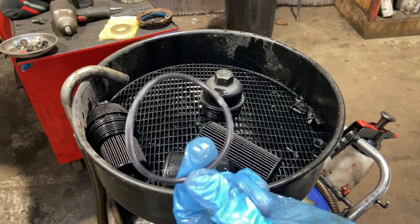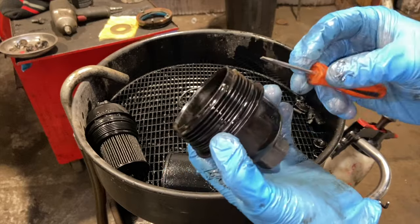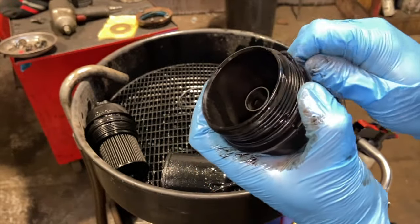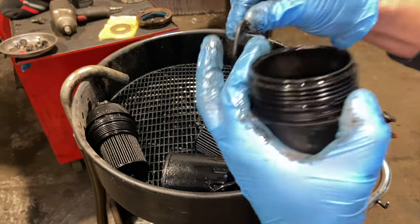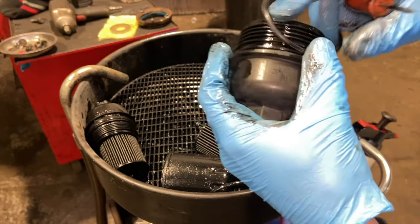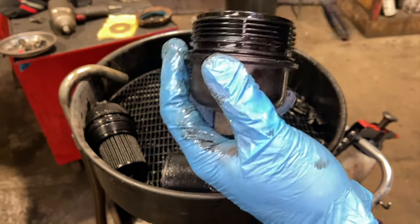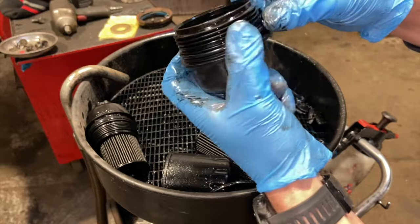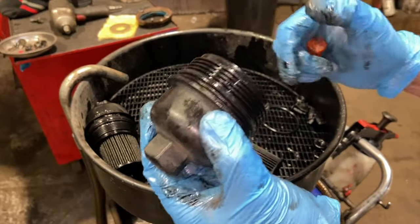Now that we've cleaned that down, we've got a new filter seal with the kit. Get a small flat-bladed screwdriver, take note of which groove the seal sits in, and just flick the screwdriver under the seal to work it off. With the new seal, just run a little bit of oil around it so it goes on nicely, then work it back round into that groove. It's easy to mix up which groove it went into, so just take note — I know that went into the bottom ridge there.